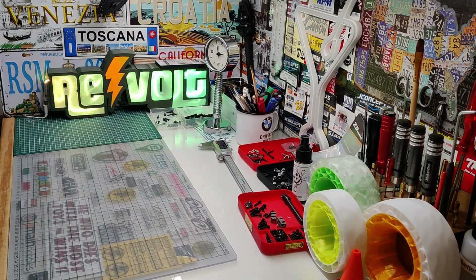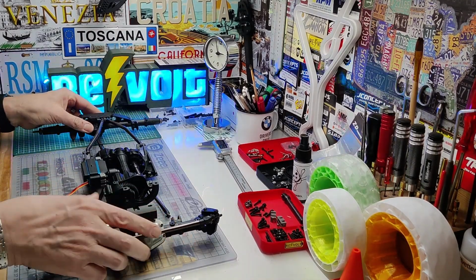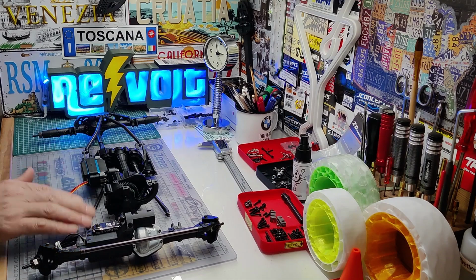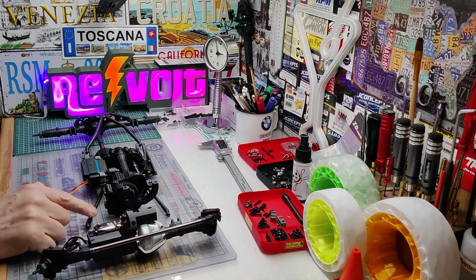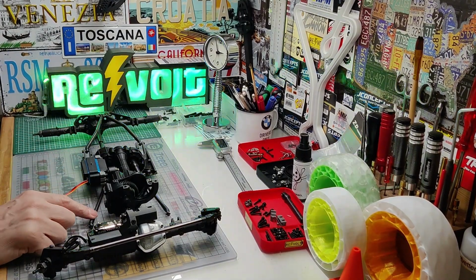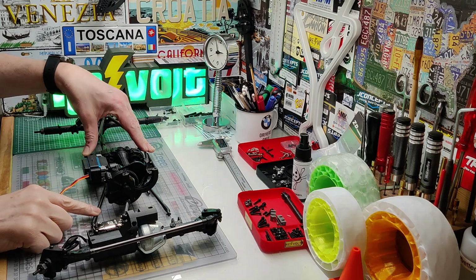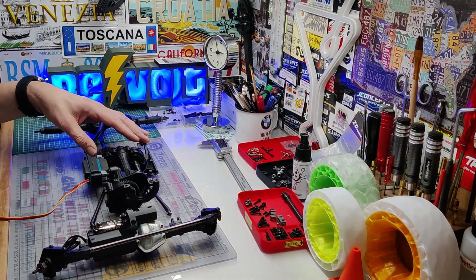But the front is something different, because it was a 3-link setup with CMS mounted servo. Bottom links are still here, which can maybe be reused. A strange thing is, the front links are longer than the rear links. These are 145, 140, 145. I should expect it the other way around. Now, we will see where that brings us.